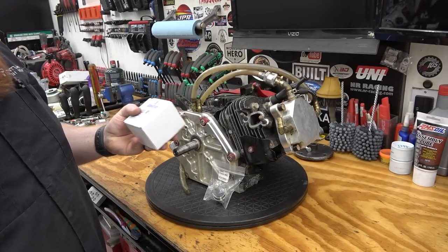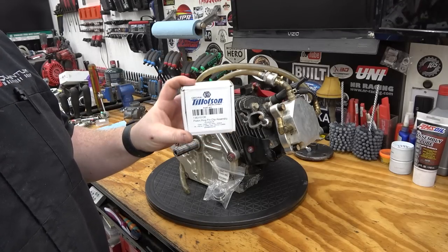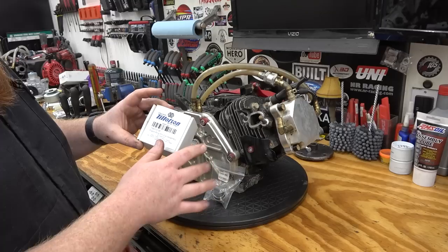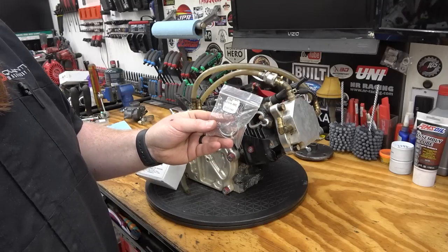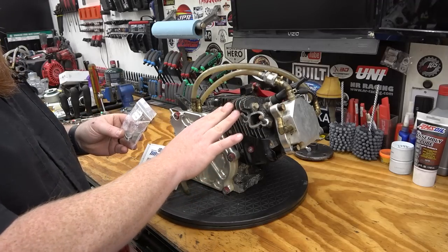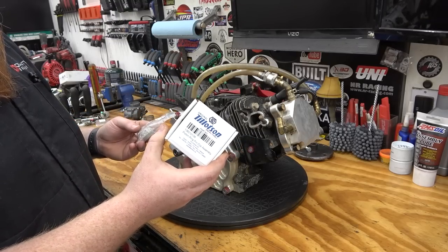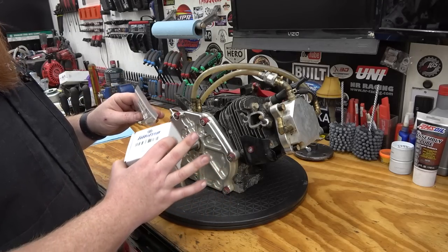So we have the 224 up on the bench. We're going to be installing a new Tillotson piston. This probably only needs rings, but a piston's not that much money — Go Power Sports has these, links are in the video description. This is the flat top that we used in this 224 build because it does not come with a flat top piston stock. For the rod, we're going to freshen up the rod bearings — this is a 6394 from Go Power Sports, this is for the clone. Since we went with the flat top piston originally, we had to use a clone rod.